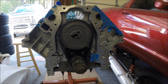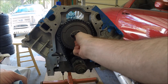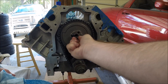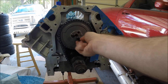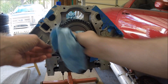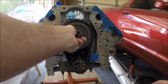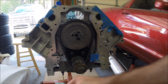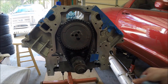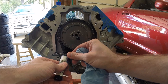Put a little bit of blue Loctite on each bolt. I've already test-fit the cam and the timing chain, so I've run these bolts in and out several times, so I know the threads inside the cam are clean. It's good to check that at least before the first time you run these bolts in and tighten them down. If it's a new cam you're probably fine, but especially if you're reusing a cam, make sure the threads in there are clean — otherwise it can affect your torque specs.